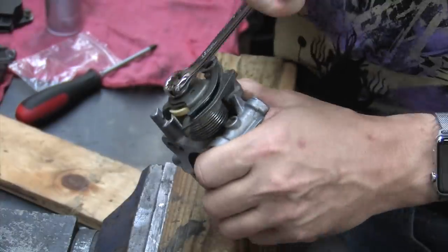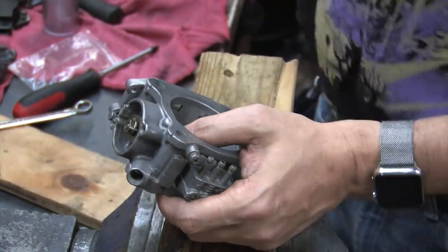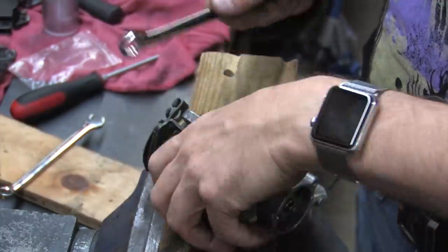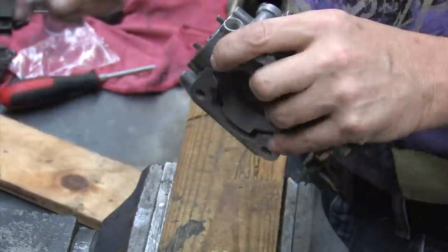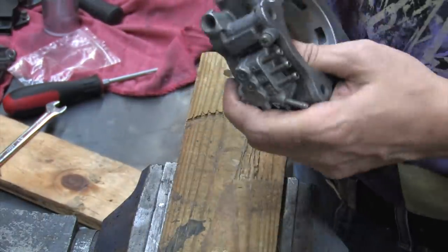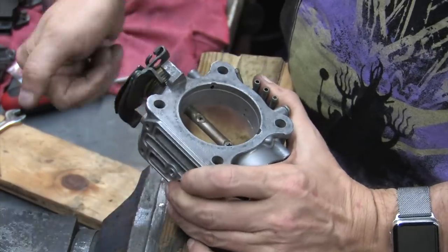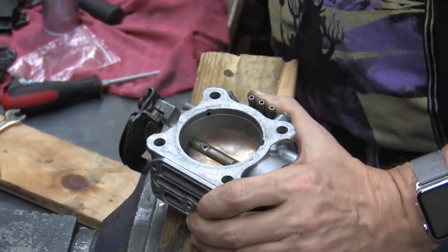Then tighten the nut. You saw the TPS shaft nut pop free when we were taking it apart. Remember on this side that it's the lock washer that keeps it all together, not the torque. Don't over-tighten this nut if you remove it. It can pull the throttle plate out of center, causing it to scuff the throttle body bore and hang it open. So once you're done on each side, check the feel of the throttle plate and make sure you're not adding a problem to your freshly rebuilt throttle body.